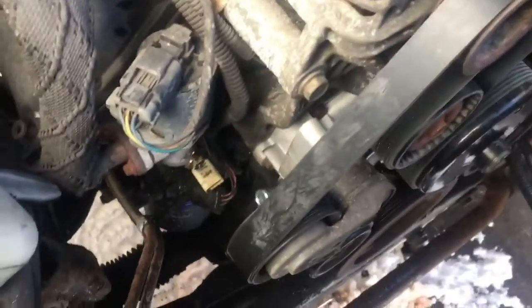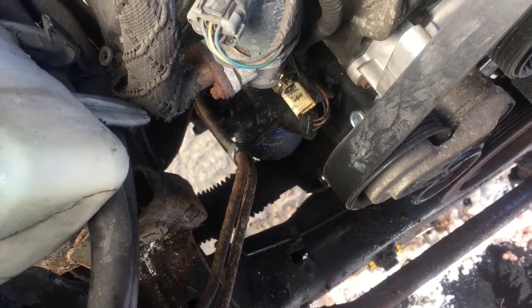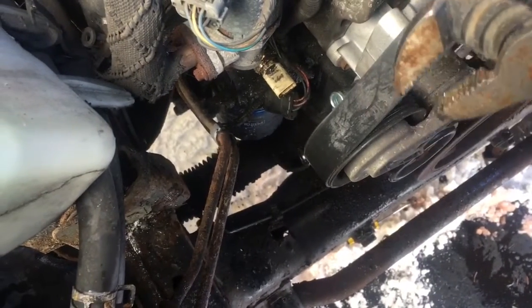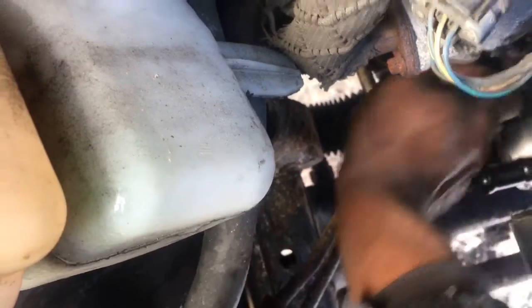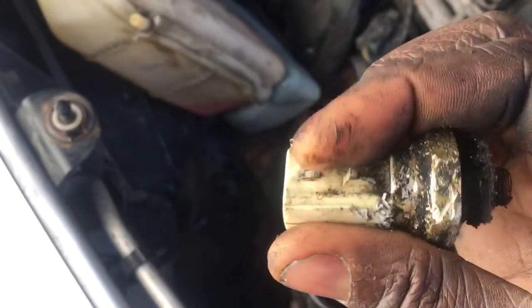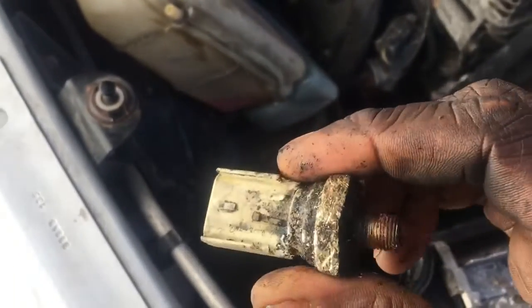The unit on here is about 1-1/8 inches, whereas what I have is 1-1/16. Because I already have all these other parts off, it's allowing me to use my channel locks to get in there and loosen it from the side — chances are you may not have this opportunity. I loosen it up, and now I'm just screwing it off by hand. There it is — look at that, it's pretty bad. There's oil all up in there; the part is loose and oil was coming through by the plug. This thing was definitely shot.